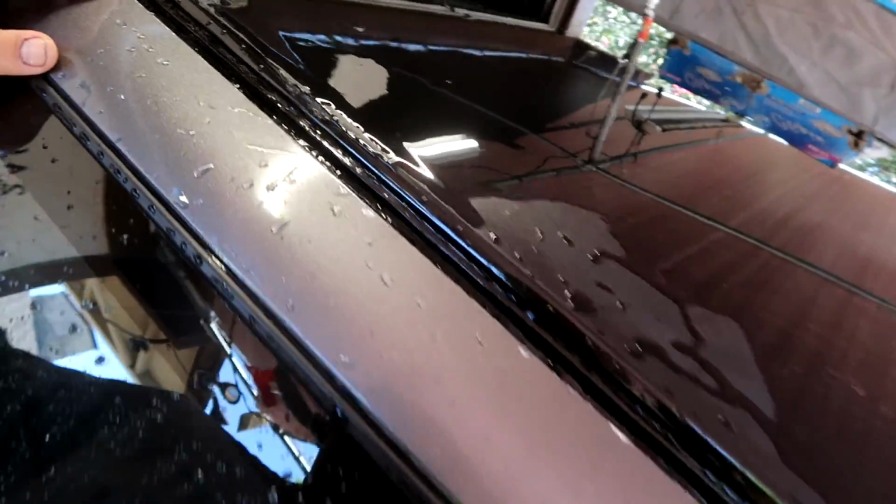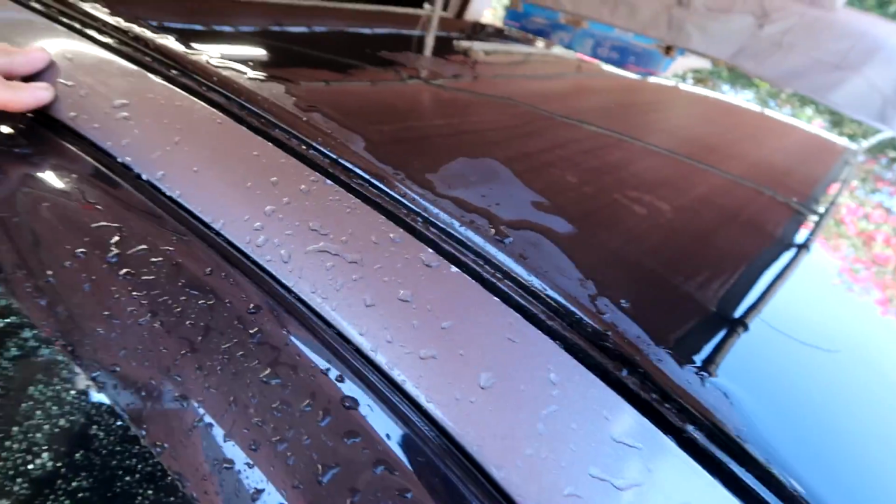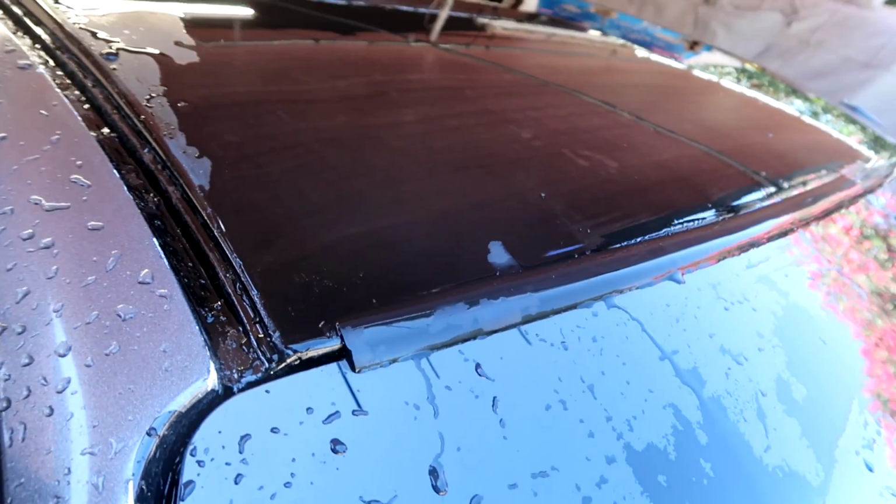I'm going to sand it with the compressor. Alright guys, so it looks like the car is not going to one of my other buddies' places to get polished out. Instead, we're going to clear coat it. So yesterday we sanded multiple grits and we had to chase a lot of spots because I was like, if we're going to clear it, we might as well try to get most of the bag off, and most of the bag is off.